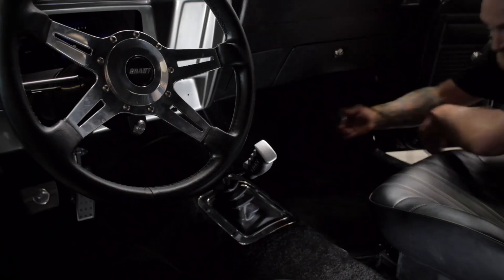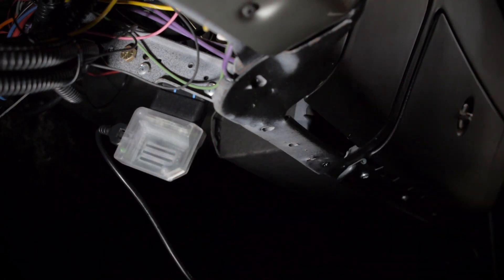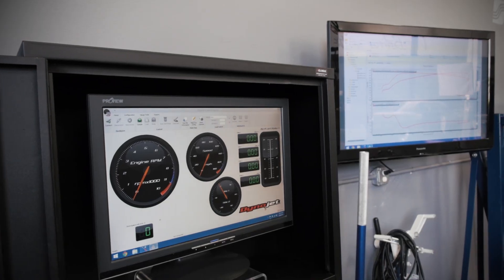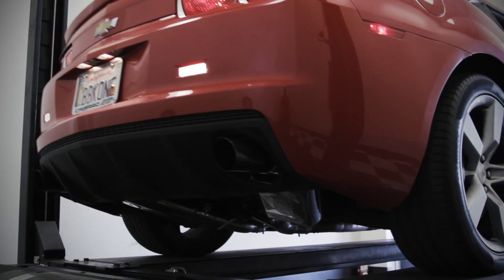The advantage of the OBD2 interface in your DynoJet dyno is its ability to bring in RPM through the OBD2 port on 1996 and newer vehicles. We can stream RPM straight from OBD2 into WinPep 8 and view it in our graphs. We can also bring in spark advance, intake air temperature, and ECT, so we can monitor all the data channels required to make your tune right the first time and ensure the vehicle is repeating consistently.